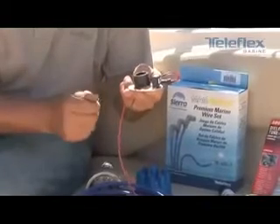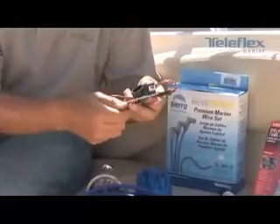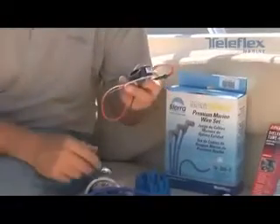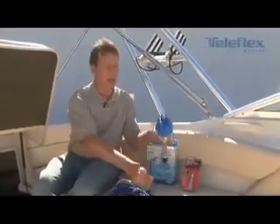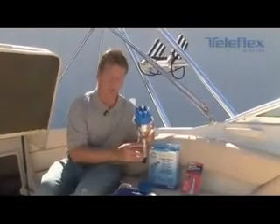The electronic conversion kit gives you years of trouble-free maintenance. Your boat will traditionally start easier and you can get a little more performance out of this application, so we don't have to worry about yearly maintenance. Remember, if the distributor shaft is loose, you could get an erratic point gap, and you would want to replace the distributor in that application.